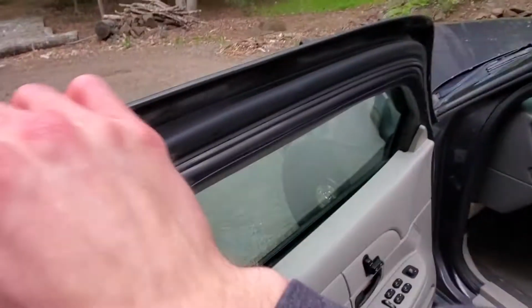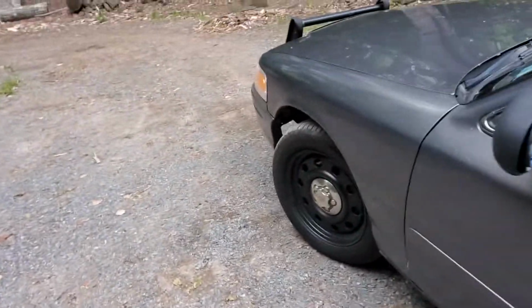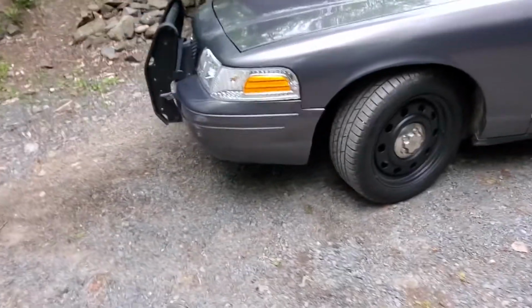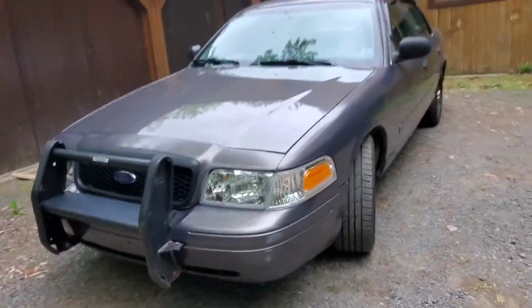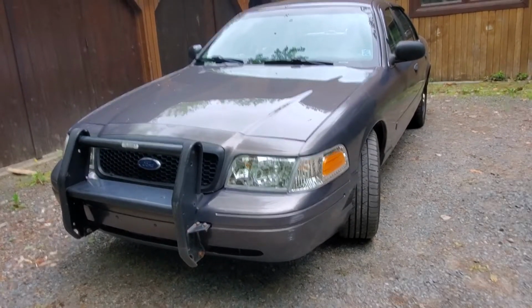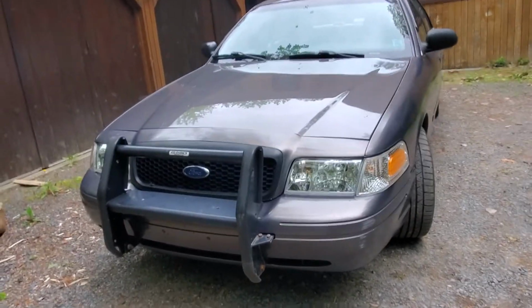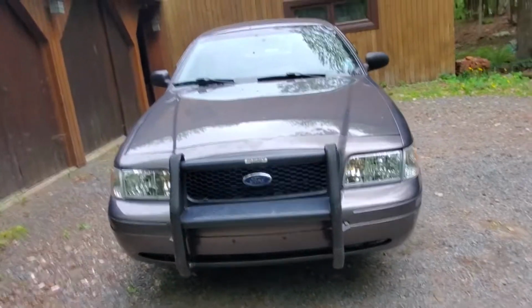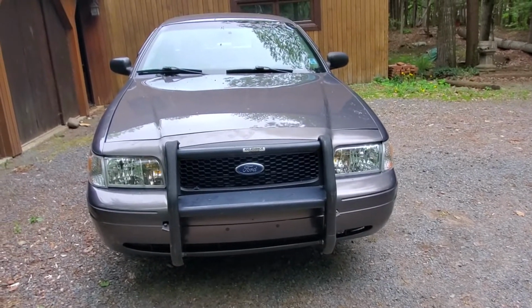Next, we're going to talk about reliability. If you want my personal opinion on which of the vehicles are probably more reliable, you're going to be looking at the Mercury Grand Marquis Ultimate Edition or just any civilian-owned Panther. At that point, you're going to be looking at the Crown Vic, Grand Marquis, and Lincoln Town Car for reliability. The only thing that's known to go out in cars with the airbags is that the airbags are prone to needing to be replaced more often, but it's very common for those to get replaced with normal coil springs afterwards. So reliability-wise, all the regular Panthers are pretty good, and you can get a very, very reliable police model,